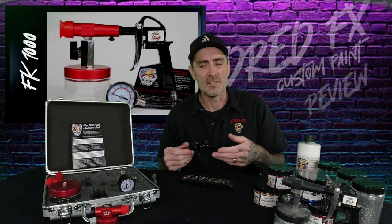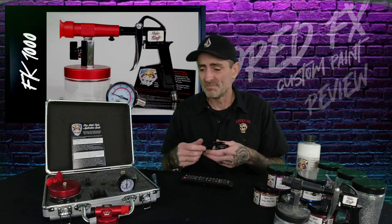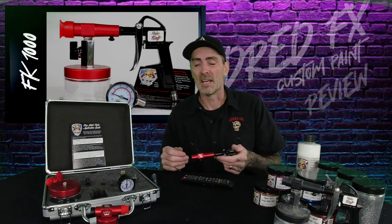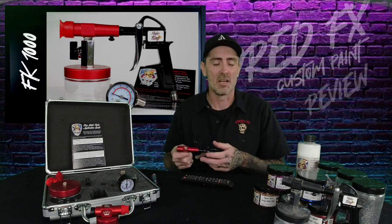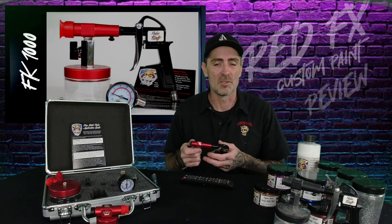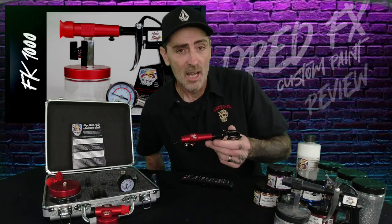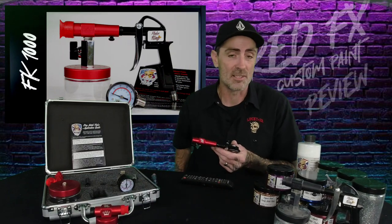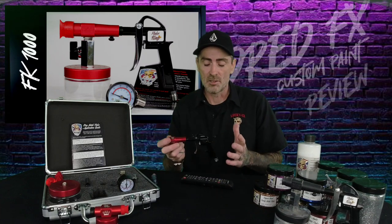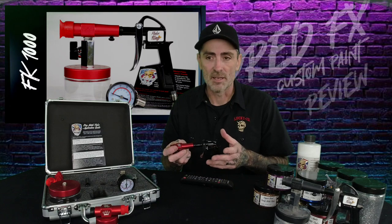You're not dipping it in thinners like if you're doing the old school metal flake where you're mixing flake with clear. You've got to really clean the gun out. You can only use one gun for that, because you wouldn't want to use your really expensive clear coat guns and start chucking flake through them, because there's nothing worse. You get on another project and you go to clear coat a car, and then all of a sudden splat, flake over it. That's all you need. So I really think it's a good, well thought application way of doing metal flake.